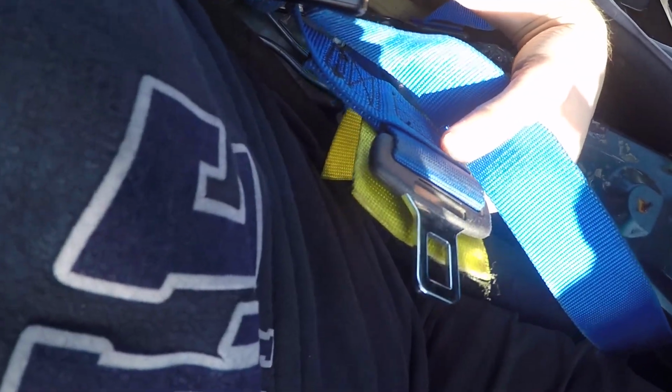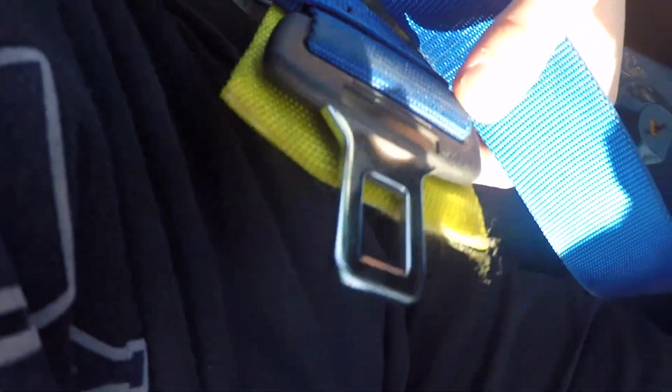Okay, and continuing, I'll tell you what I think is essential, and then you can take it from there. First thing is, get some bucket seats. I know it's obvious, but they hold you in, they make a big difference, and you can get proper harnesses on them. Obviously your harness is the next point. Don't have to get 6-point. These are 3-point. They're like a lap style, they're much easier. It's up to you. Because you're going for harnesses, you need a harness bar. It's just simple as that.